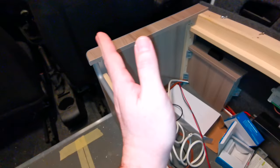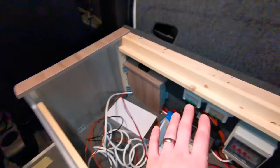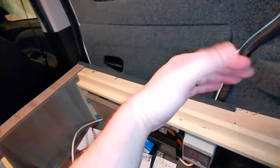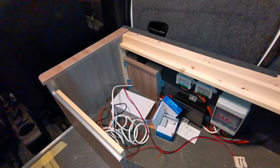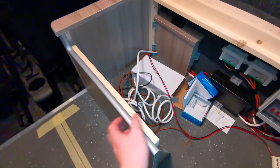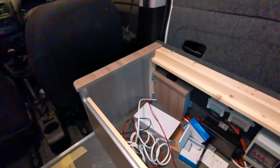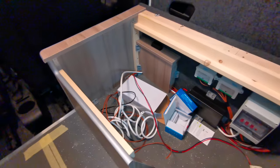Make sure your rail is on first and you know where the bed front is going to land. Rule of thumb: on a big bench seat setup I normally do the cushion 27 inches deep, because you'll have a 4 or 5 inch backrest leaving about 22-23 inches of seat base, which is ample. So I set the frame at about 25 or 26 inches from the back rail. Everyone's conversion will be different, but that's a solid starting guideline.